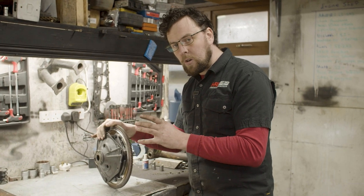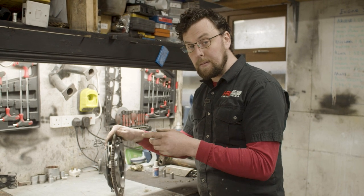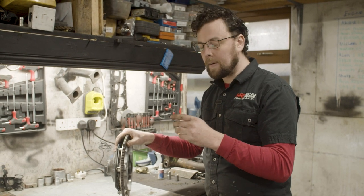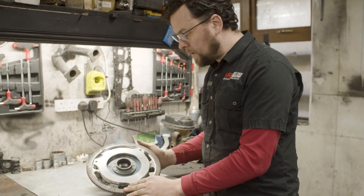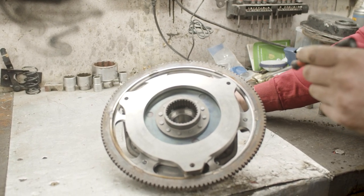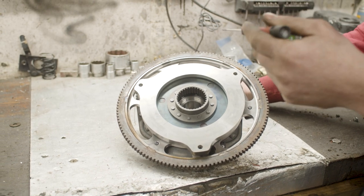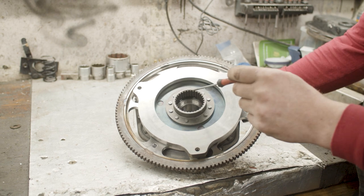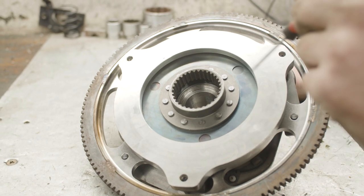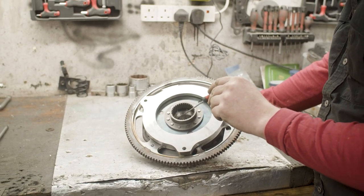The whole assembly will be in a much more balanced setup — everything will be where it should be. It would work and it is in balance as far as rotating balance but it isn't optimized. I'm going to show you the difference between being optimized and how we get it there. Another thing we're going to do — this is a trade secret that I'm going to give away to you guys on the channel — a problem can occur with these flywheels especially on older crankshafts where the flywheel can move up the crankshaft. This recess in here is there for a reason.